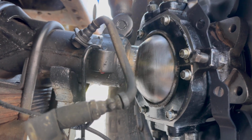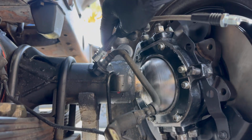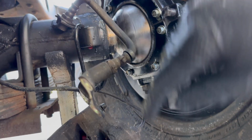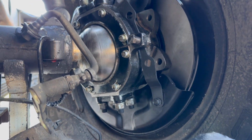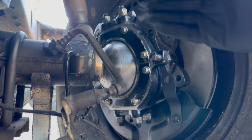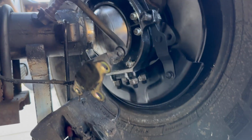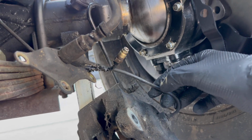I wanted to show you way up close some of the things that this brake line kit addresses. So you've got this one that goes here, and then this line will now go directly into the caliper. And the reason why I'm bringing that up is when I took it apart, I thought it was very strange that this bracket right here bolted to the top of this shield. If you ever needed to change your brake pads, you have this hard line because this soft line bolts to the shield so you can turn, but then they went to a hard line which goes to the caliper. So you would have to take this whole mess off every time you want to service the brakes. Now, since it's going to be soft line directly to the caliper, I can just unbolt it and move it around with free play. I don't need to worry about this hard line getting in the way of anything.